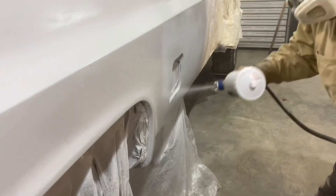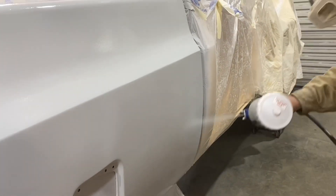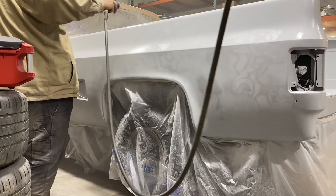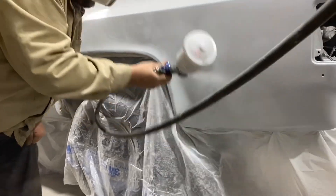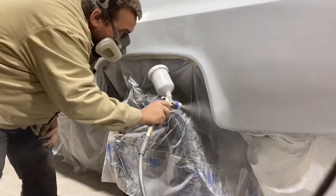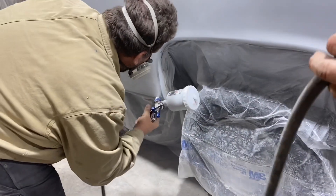This is the vertical coat — I wanted to make sure I got good coverage on everything. Of course, the bottom's all been painted already once. My brothers have both pointed out that I skipped the portion over the passenger side fuel fill there and just kind of went right past it. But once I did this vertical coat, I did come back later with another horizontal coat, so it ended up with one tack coat and then two really good wet coats. This is that vertical coat on the driver's side — pretty happy with how flat I got everything. There is still a little bit of work that could be done, but this isn't a show truck or a SEMA truck — it's just going to be a daily driver — and with that really light paint on it, you're not going to see a whole lot of the body imperfections anyway.